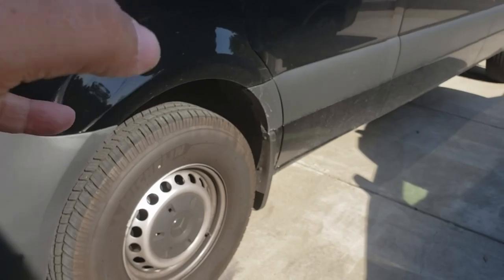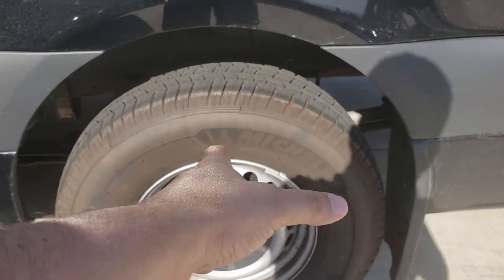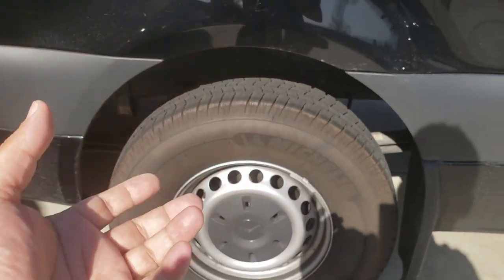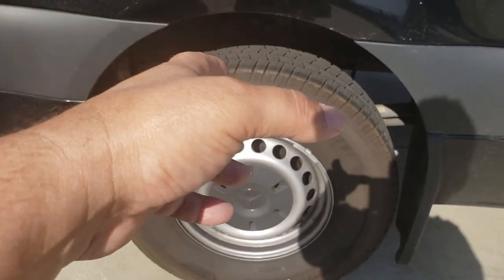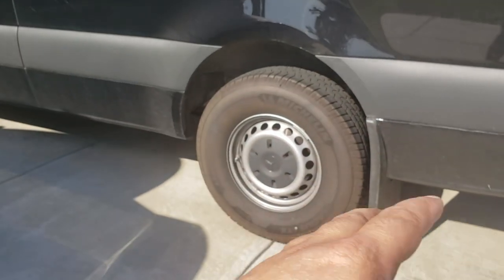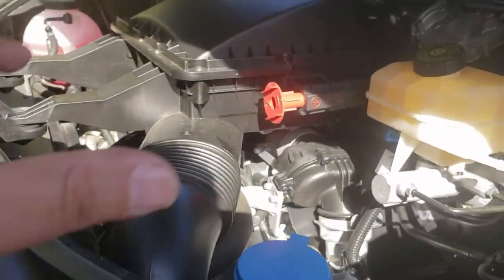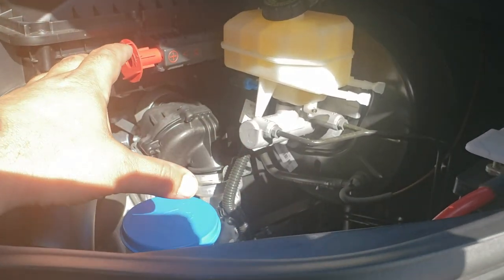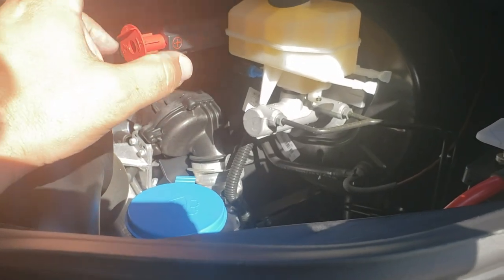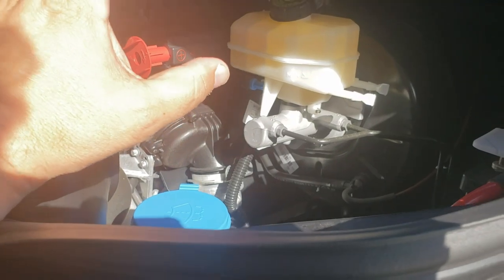This is not a dually on the 2500, so I can service everything myself — rear differential fluid, brakes, and more. The tires are going to be very expensive to replace, so don't go cheap on tires. With the height of this vehicle, a blowout on the freeway would be a very bad situation. Everything else is pretty low maintenance. I would stay ahead of transmission services since this has the new seven-speed transmission versus the older tried-and-true five-speed.